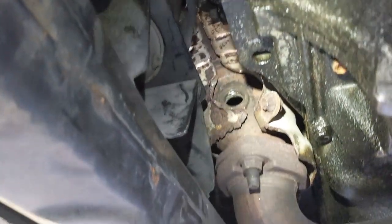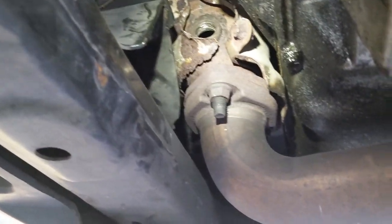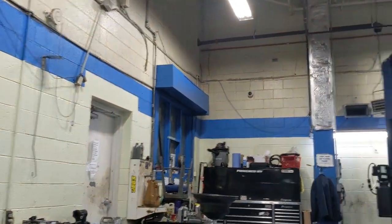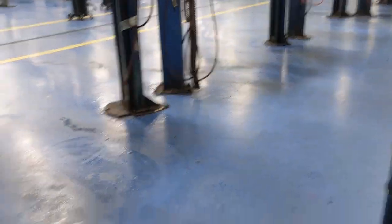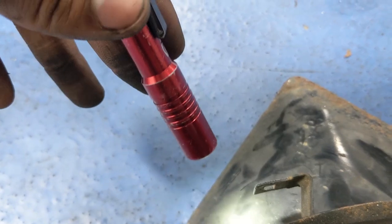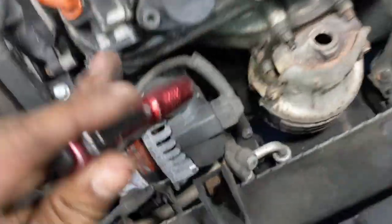You can sort of see where I mangled the hole on the old one. Those heat shields are a bit rough — maybe I should have just gotten new ones. Worst case, I'll cut those out and put a nut and bolt in. There are two clips: this one here you just pop off with a little flat head screwdriver, and one down there that clips onto a little tab. You can pop that off with a flat head, or if you're flexible, maybe reach it with your fingers. And just like that, it's out.